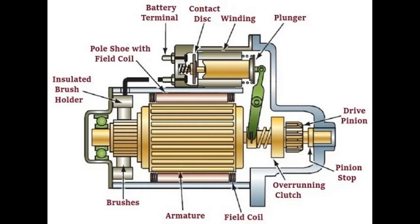What happens is when you turn your key, power goes to your solenoid on the top. The solenoid engages and pulls backward, and the green lever forces the bendix gear into the flywheel teeth. Once that's engaged correctly, the solenoid is allowed to go fully to the rear, and what you can see there is a contact disc. That contact disc makes contact with the terminals, which allow power from the battery through to the starter motor to turn the motor.